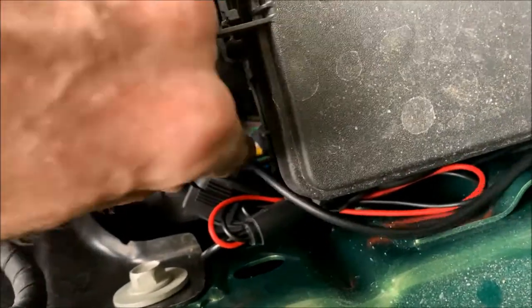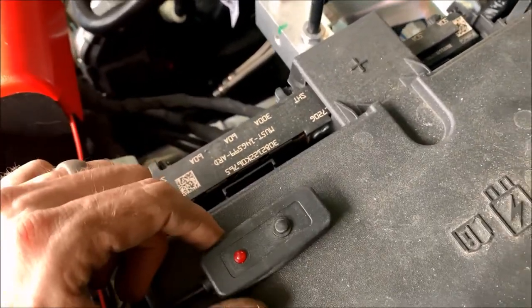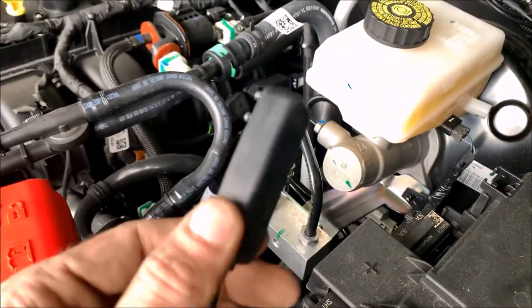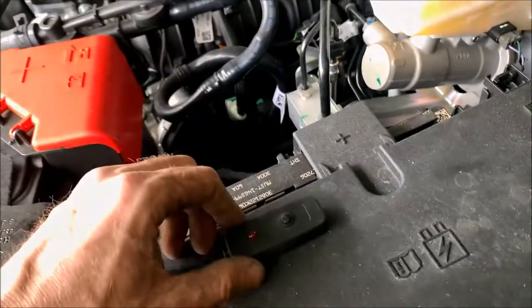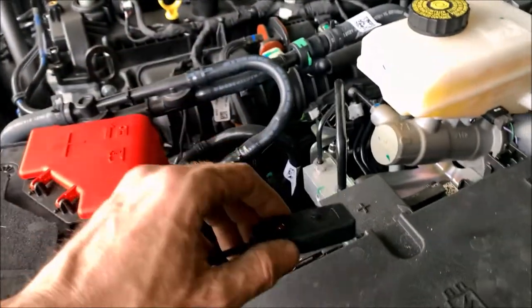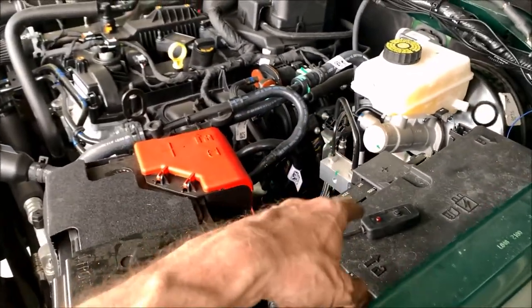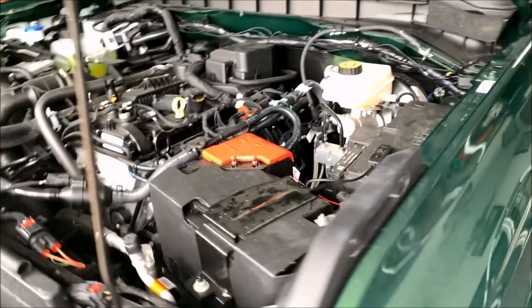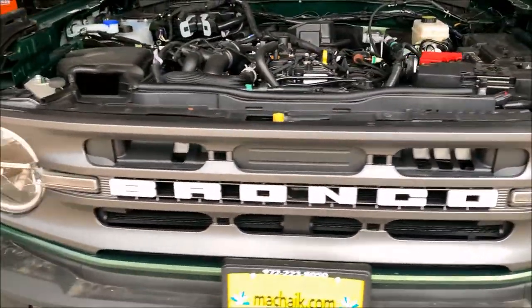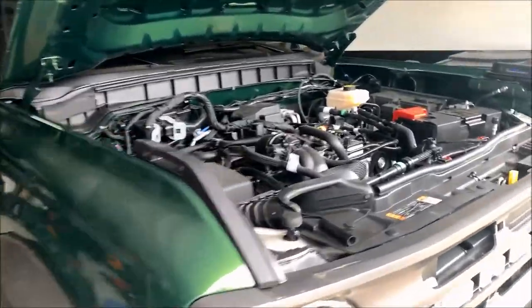Following the power and ground wire here — it comes all the way behind the fuse box and I've got it zip tied into a little bundle. You saw yesterday where my ground and power was. The switch — I planned on mounting it on top of the fuse box, though she may want it on the inside of the vehicle. I would really hate to run it all the way through and drill a big hole. These LEDs do not draw a whole lot of current — I've had them on motorcycles and on my Focus ST connected directly to the battery on a switch just like this, and I never had any issues with them draining the battery at all. The install is complete. I'm going to wait for it to get dark and then pull the Bronco in the driveway and give you guys a glimpse of what it looks like with all the lights on, then give my friend a call so she can come pick it up.